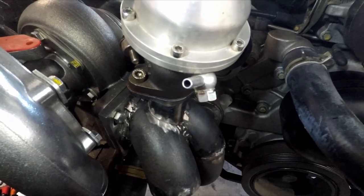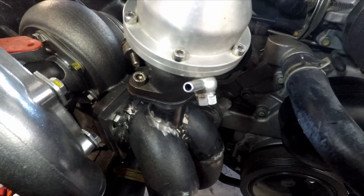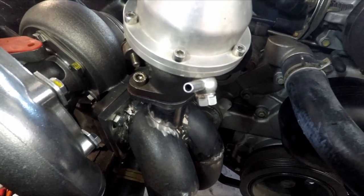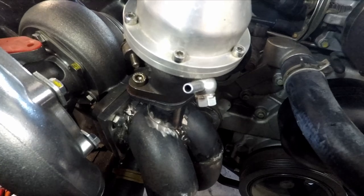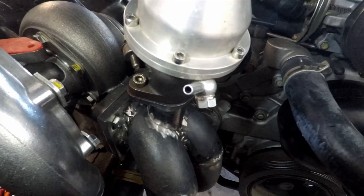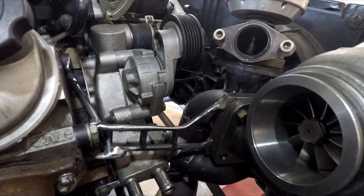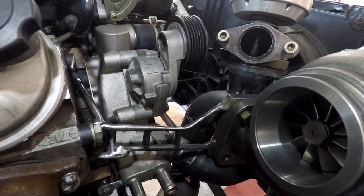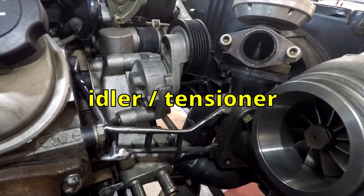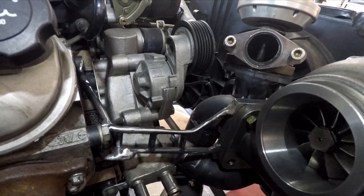Where that feeds into the piping there is around about a 75 degree angle or so. You want to be closer to 45, but I think 75 is okay — it's a lot better than 90, and even 90 degrees will work. From the other side you can see it's going to exit right between my idler pulley for the serpentine belt and the turbo housing, and then I'll plumb it into the downpipe.